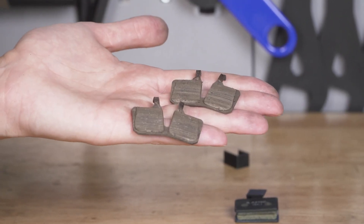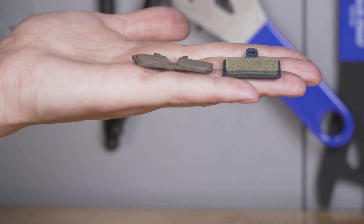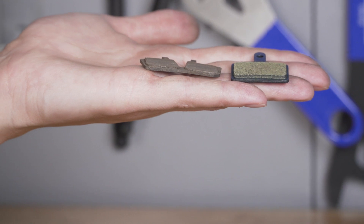Just remember to lay off the brakes. However, if you do check your brake pads and realize that there's not actually much left on them, maybe a millimeter and a half, then it is time to change them up. Same goes if they're damaged, or if you're changing your riding style by going somewhere new, or racing, then it's a good time to put in some fresh brake pads.